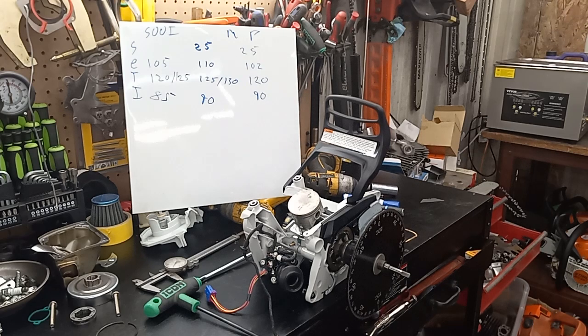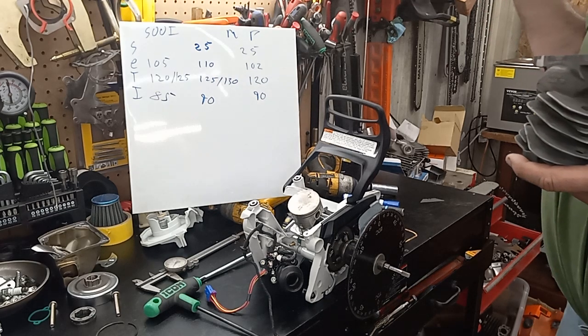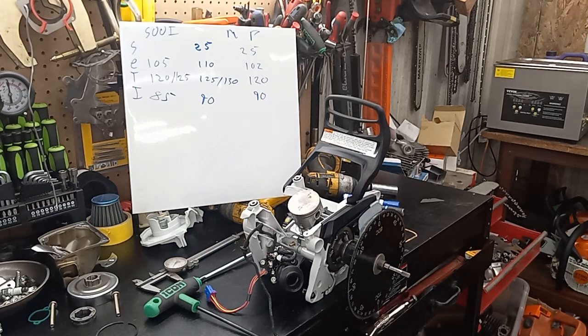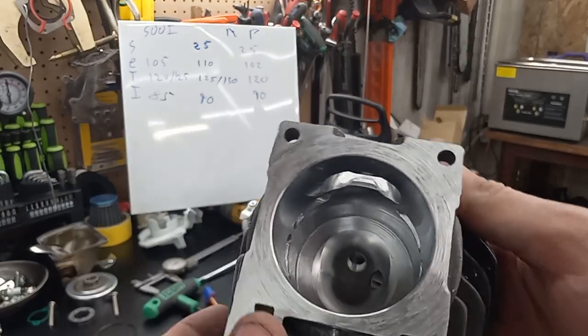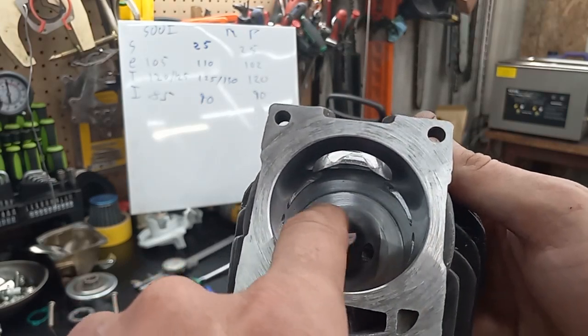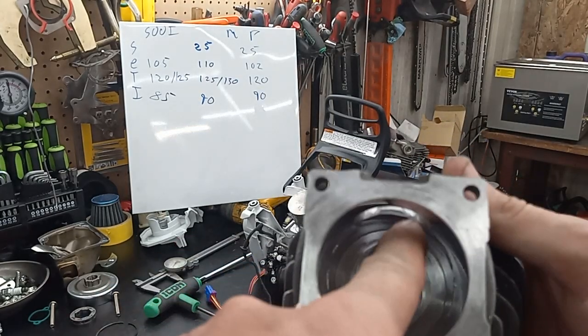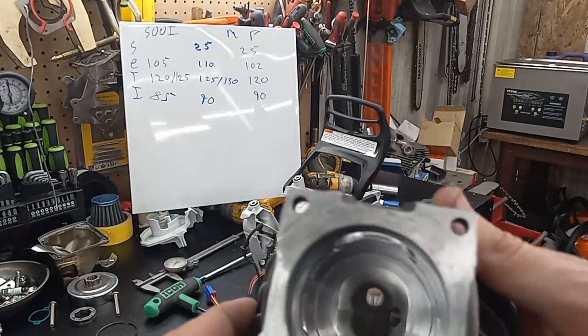My 462 has medium blowdown and runs really good too, but I had moderately short blowdown on the one he got from me, so I wanted to stick with a formula I knew he'd like. I used Dino Joe's chamber cutter and took 45 out with that, then put 120 grit sandpaper on a sanding apparatus and cleaned it up. If you're using Dino Joe's chamber cutter and want your chambers to look clean, build a sanding apparatus, go in real slow — you do not want sandpaper crumbs in between there. That's a 120 grit finish.